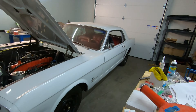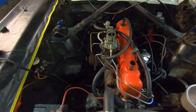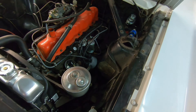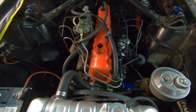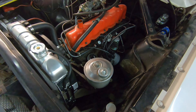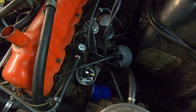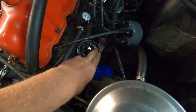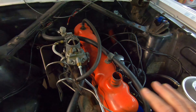Hey everyone, and welcome back to Alps Mustang Garage, bringing you another video to help keep your Mustang on the road and out of the garage. Today we are working on this super awesome 65 inline-six car. We have an issue with the timing advancing on acceleration or on load. There are some really good articles that I will post links to in the description from ford6.com that are very helpful when it comes to understanding this, just in case I don't get everything out. Essentially, I'm going to show you how to test that your Vacuum Advance system is working properly and explain how this system works.